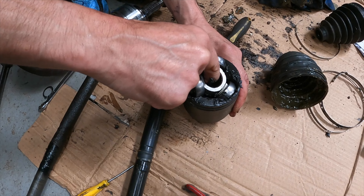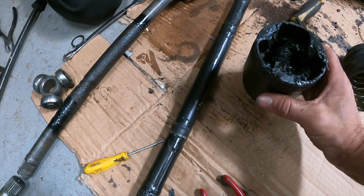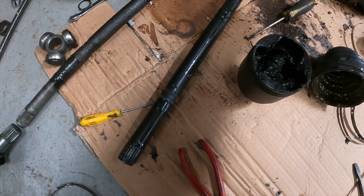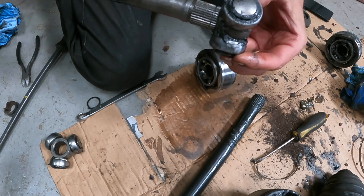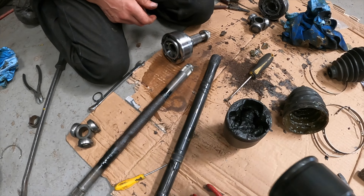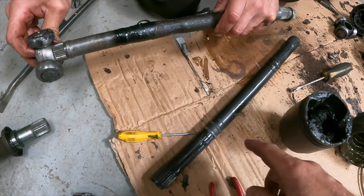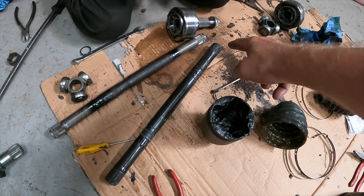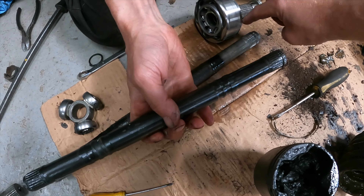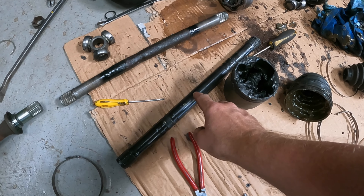The first problem we've had with these shafts: I bought a whole shaft from J and R Shafts because I needed the piece that goes onto the split shaft — the intermediate shaft. It turns out the bearing in the center is huge. Luckily, the CV joint I bought from J and R Shafts for the EP3 has the perfect bearing, so we can still build one shaft. But the brand new drive shaft they sent has different outside splines to a standard EP3 one — they don't fit the B-series CVs. If you pick up a standard EP3 shaft, it fits beautifully — no problem.